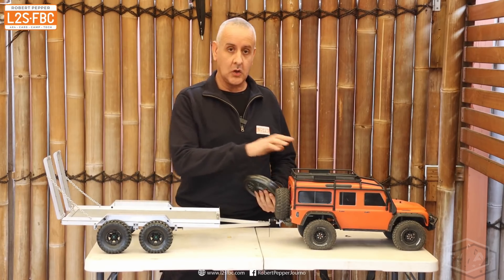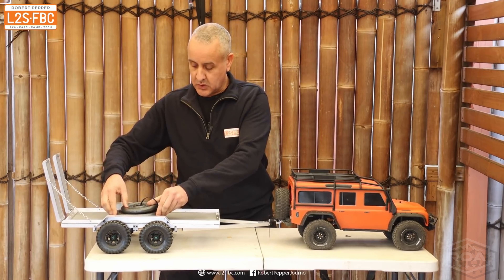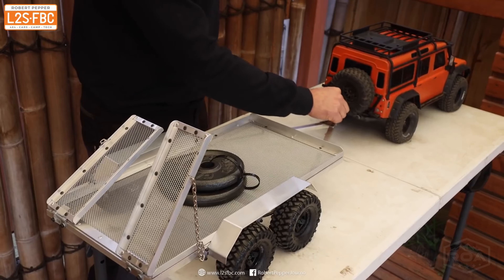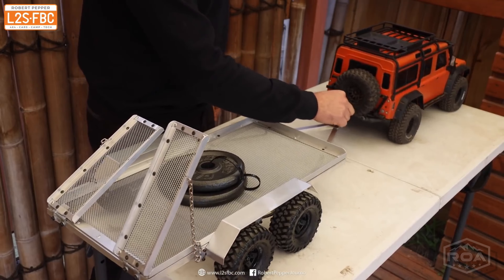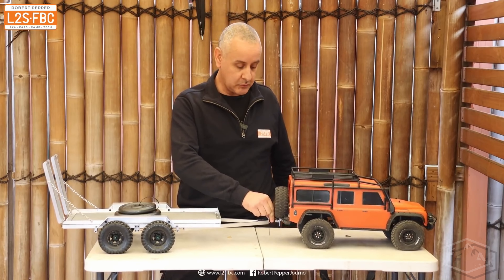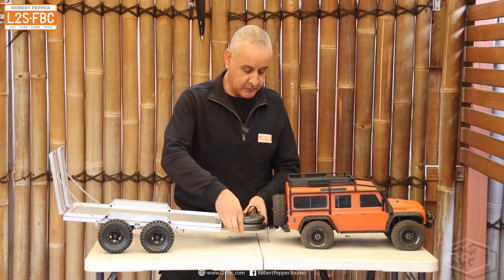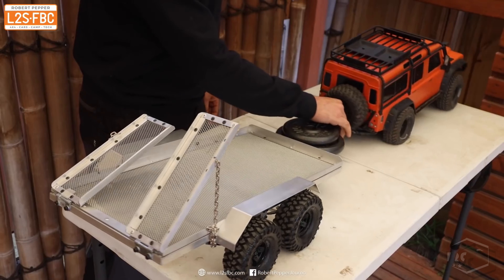Back to the unstable configuration going up about an 8 degree slope — we displace it and it actually settles back down, just takes a while. The same configuration at the same speed on flat ground just gets out of control. So going uphill you're less likely to get sway, but conversely going downhill you're more likely to get sway.